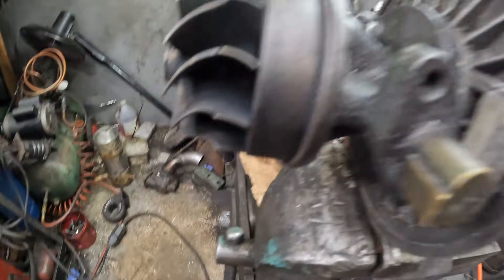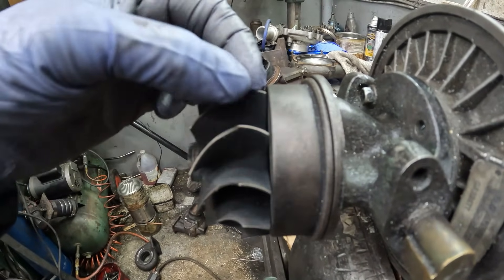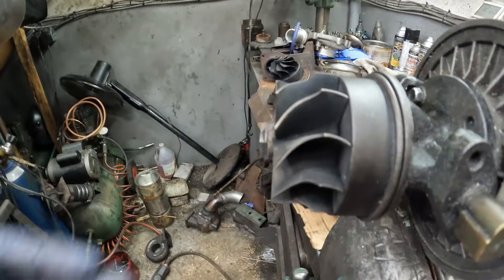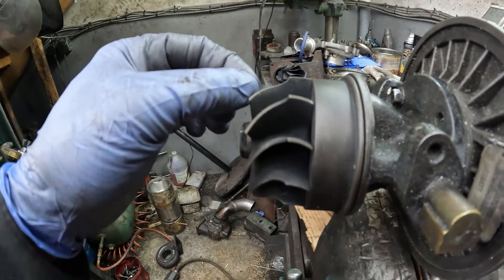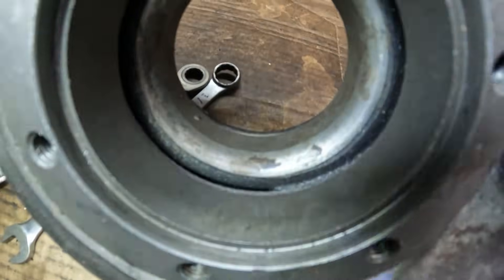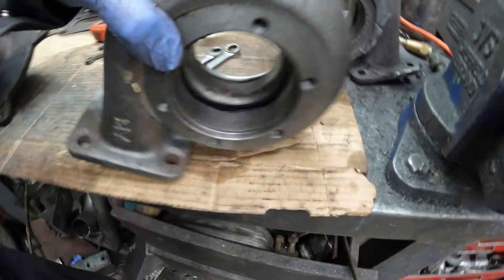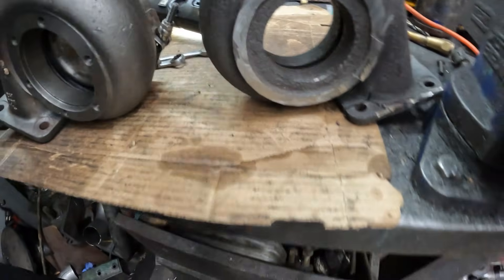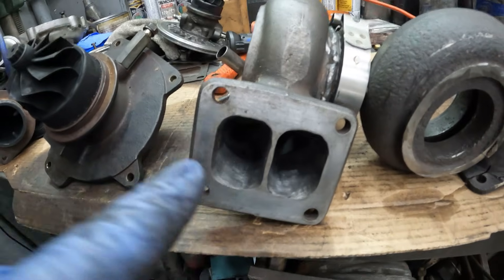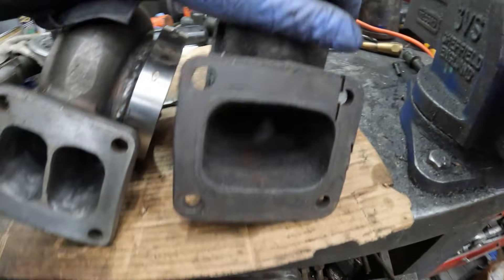They hit the largest inducer here, they come in, they hit this and they spin that. As the gases get used, they come down here and out. As they slow down, they hit this wall and spin that turbine faster. It's got a little divider in the middle. So when the gases come out of the exhaust manifold, they get divided and they run down those two channels instead of running down the open housing.